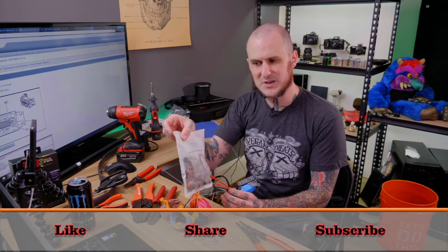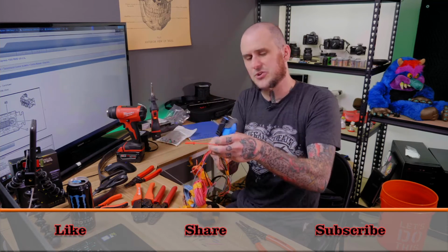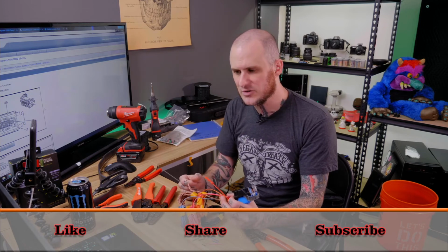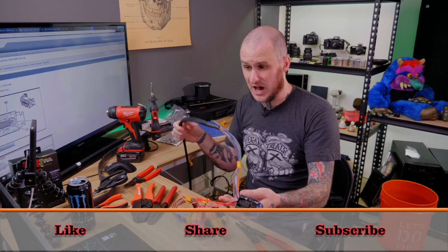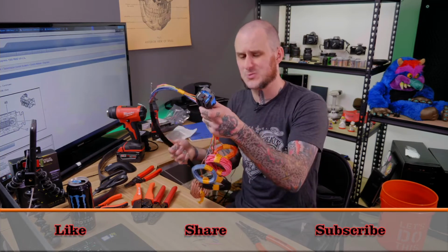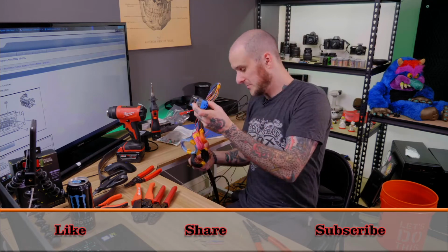I'm going to go to a 6-pin Deutsch connector on these, so that basically when I'm all said and done, this transmission harness is going to be completely separate of the engine harness. I didn't need to do that. I did it, quite honestly, because it allowed me to keep moving and bring this harness home. The engine harness wasn't ready for me to bring home and do at home. The transmission harness was. So that's that.